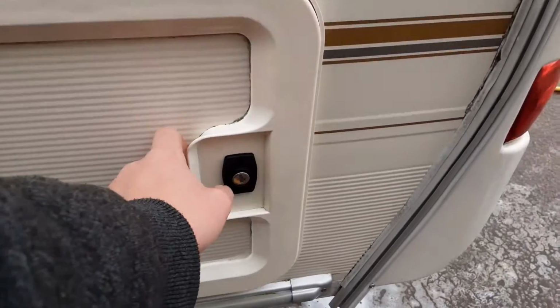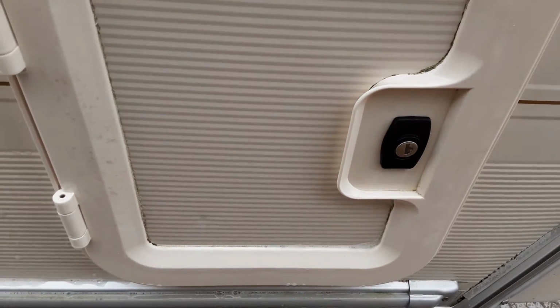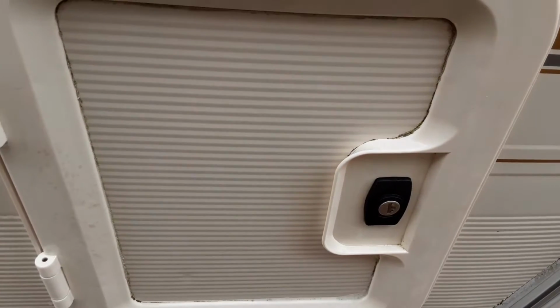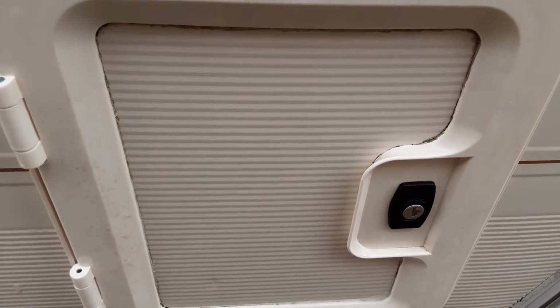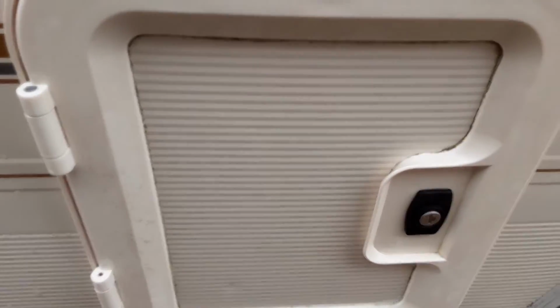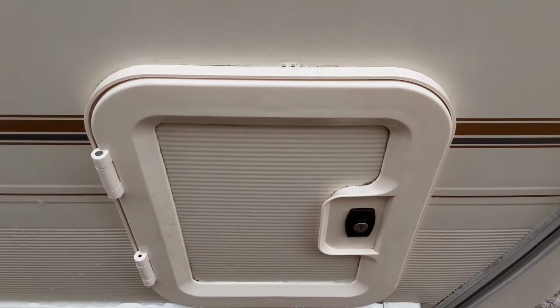Then at the bottom, you've got your toilet waste cassette, which you'll open up. Green handle at the bottom, you'll lift up and pull the cassette towards you. On top, there'll be a neck you turn out to tip the waste away. And there's a yellow cap on there, which is a measure for your pink and your blue fluid. In that cassette, you'll need to put 1 litre of water and a cap full of the blue fluid prior to use.